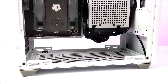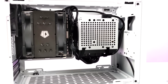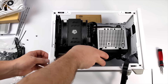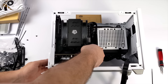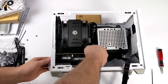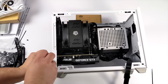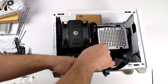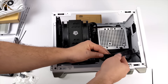So far I think it's turning out pretty decently. I was worried about the cable management at first seeing how open this case is, but with that modular power supply everything tucks away pretty nicely. Now it's time to throw that 1660 in. One thing I really love about this case is it supports full-size GPUs up to three slots, so when GPU prices come down I don't have to be too picky about what I put in here. I'll also add my 2TB Western Digital 3.5-inch drive.